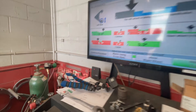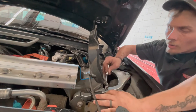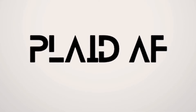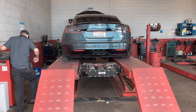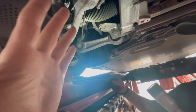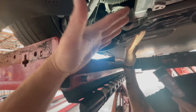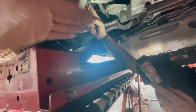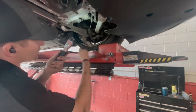The goal for caster is 4.7 but it's already all the way tight. When we flip the pill and add two more degrees of camber, it's going to force the wheel to turn out — it'll camber it in and toe it out at the same time. So then you have to turn this clockwise a full rotation to pull the toe back in. On that one you have to do the same thing — go clockwise, a full rotation.